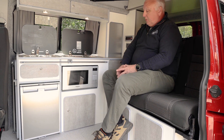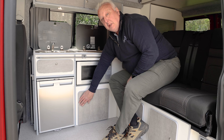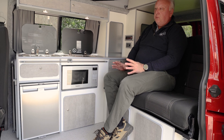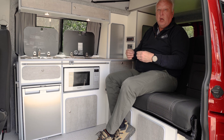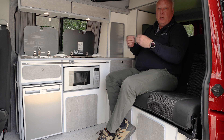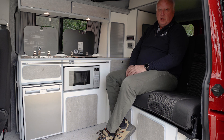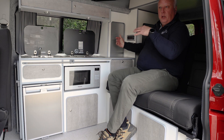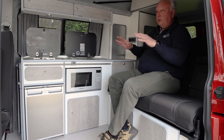The leisure battery is situated in the kitchen cupboard here in a safety box. It shouldn't really need to be tampered with — it just looks after itself. Our system is fully automatic switchover: when you plug into the mains the mains charger kicks in; if you unplug and you've got a solar panel the solar panel kicks in; and when you turn the engine on the engine kicks in for charging. Fully automated, no switches to change. It's also worth noting that if the panel's switched off you'll still be charging as you drive, on the mains, or via solar — it's all taken care of in the background.